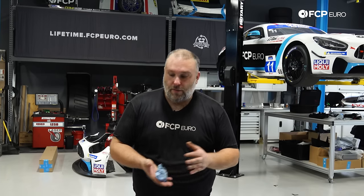So one thing that I can definitely say for sure is if you have an N55 and you're doing any type of repair like that, disconnect the injectors, even pull the spark plugs, crank it 3 times for 10 seconds. That way you can prime the entire oiling circuit, and that should hopefully prevent any kind of problem like this from happening from that repair. But it is known, it is documented, it does happen. So don't know if that was the situation here, but just wanna let you know that there is a service bulletin from BMW pertaining to all engines, but it did stem from the N55 having these problems in the dealer environment. We do have a lot of repair content on the N55 engine. That's an ever increasing thing as these engines become older. We're gonna touch base on pretty much all of that.